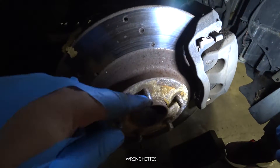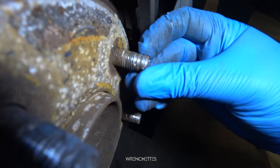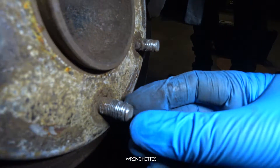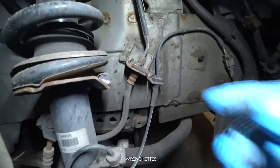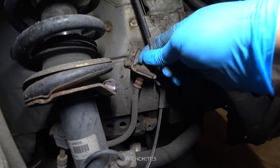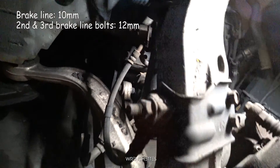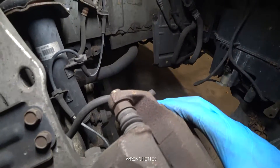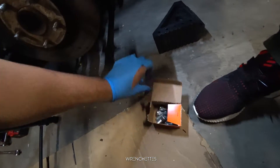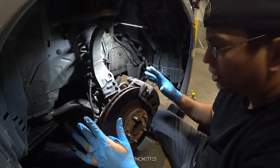These are the studs that I'm gonna change — look at how bad these things are. Look at that, that's bad — it's like a deeper groove in this one too, this one too. That's called danger, and this one too. So this is why I'm changing everything. For the rear, you have a clip here, you have the brake line here — we'll screw that and take up the clip which might be seized. After that, we're gonna unbolt that one here and that one here. I'm gonna route the new stainless steel line all the way down. To take out the caliper, it's gonna be that bolt and that bolt. We're gonna use these puppies to replace those puppies, and we'll use the ABN kit — link is in the description.